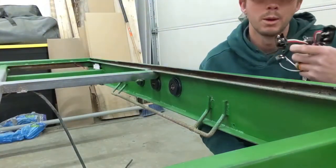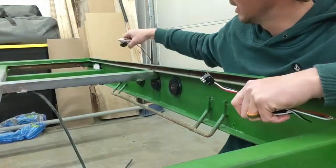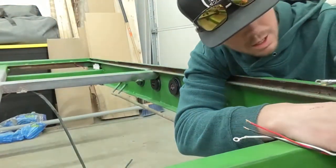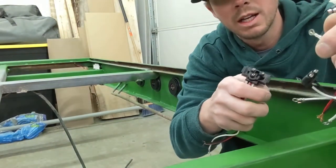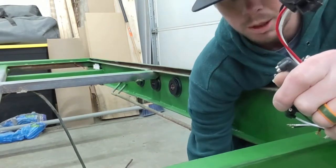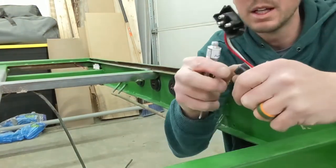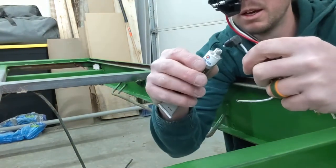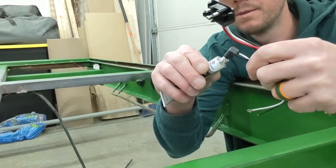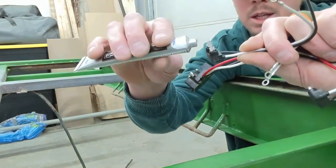Now I'm going to attach all my wiring harnesses. Something I noticed with my 6-inch oval tail lights is they came with a little bit of tape covering the contacts, and behind the tape there's already a little bit of dielectric grease. I don't need to add it for those — I'm just going to take a little dab on each contact for the round lights before I stick them in.